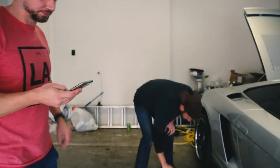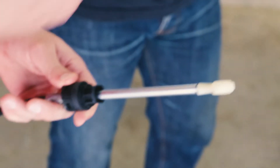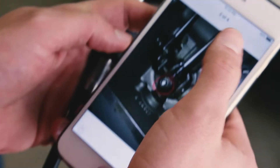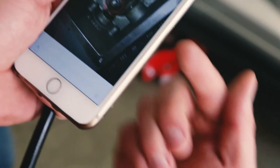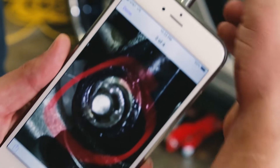So tell us the problem you're having. Took the car out and it started popping out of third gear. I didn't think anything of it, then it popped out of fifth gear too. Pulled it apart and it is the shift bushing — the bushing in the shift linkage — that was broken. So this bushing inside here completely blew apart. This is the end that goes into the bottom of the actual shifter.